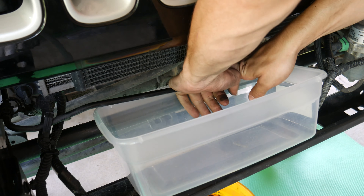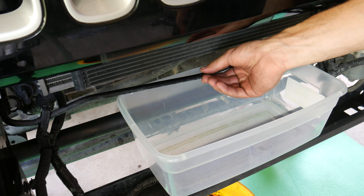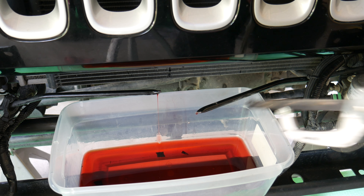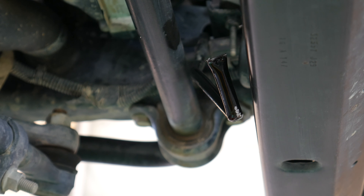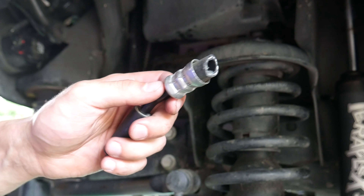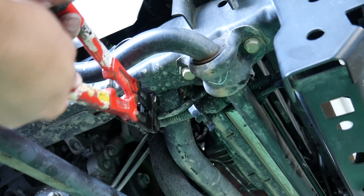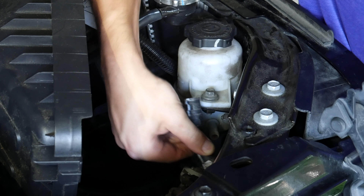I'm going to bend it into this bucket so we won't get any spills outside our spill bucket. The instructions say to use a small tube cutter, but I don't have one so I'm just going to use a set of bolt cutters. The bolt cutter method kind of pinched off the pipe so we got a really slow drip. I tried to help it by sawing at the bottom of one of the tubes, but it did work and we've got most of the power steering fluid out of the Jeep. Starting at the driver's side, I cut the line with bolt cutters and then chopped off the lower end of the rubber tubing with a box cutter. I pried off the plastic retainer clip and removed all the line from the driver's side. I broke out the bolt cutters again to remove the bottom portion of the line from the passenger side, then disconnected the line from the power steering reservoir and removed all that was left.